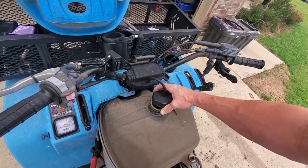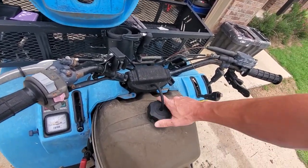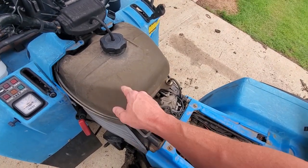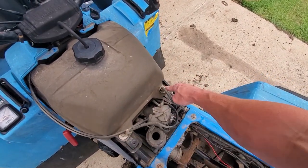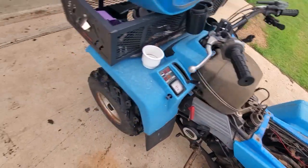Because it is way too annoying to reach. Right now my fuel tank is only held on by this bolt and this bolt — we need a 10 millimeter. Let's get that fuel tank out of there.